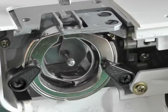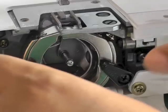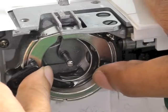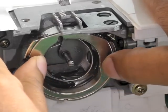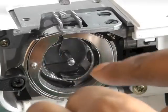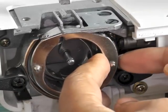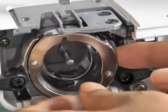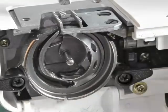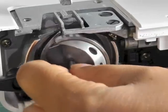The next area to focus on is where the bobbin actually lives, and this area is called the hook race. So I've got two levers here and I'm going to pull those away from the bobbin area, and then this is what you call the hook race ring — we're going to release that. It more or less just drops out, and then the hook race itself.